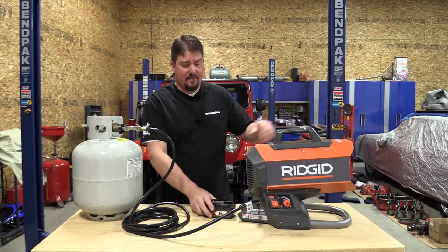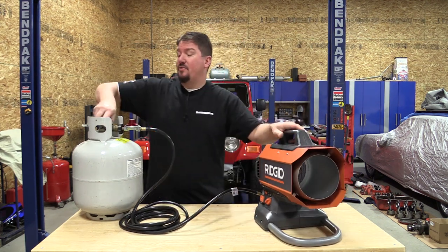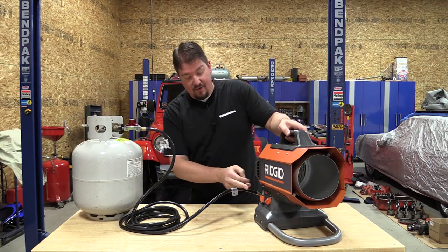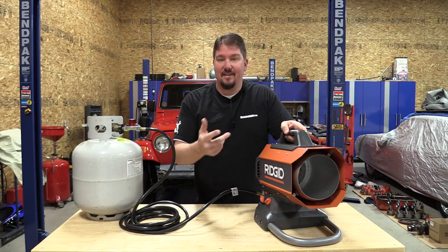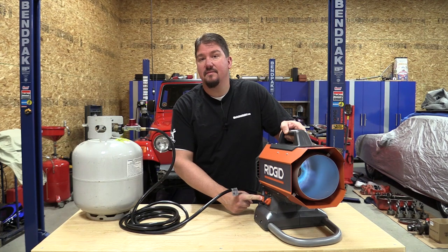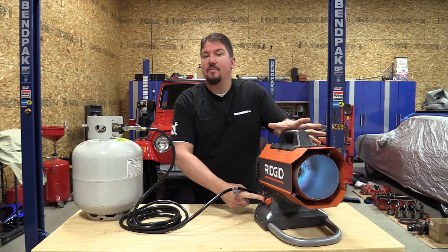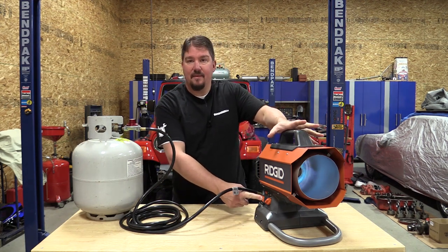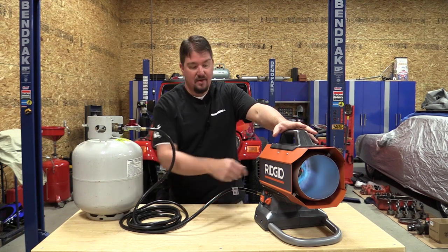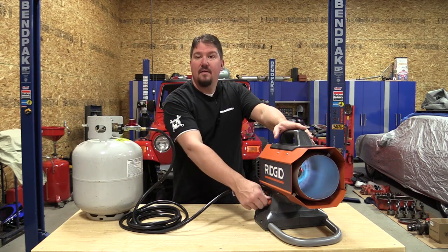The starting procedure on this is very simple. First, make sure you have a battery or an extension cord plugged in in the back. Make sure you have some propane going to it — without propane we won't make heat. Push your power button; that will start the fan and you'll hear some clicking, that's the electronic ignition. You push and hold the flame button for five seconds. That'll get the flame going, and there's a temperature sensor in there that makes sure the gas is going and there's a flame, so that keeps the gas moving through. Then you can adjust your dial from low up to high.